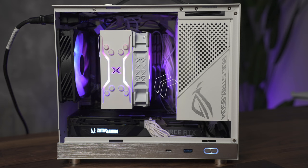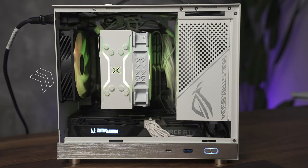One fan attached to the CPU cooler, and another helping exhaust out the back. You can install two 120 millimeter fans at the bottom, but like I mentioned before, they need to be thin. Otherwise, they will interfere with the GPU. Personally, I think that the GPU will be pulling in enough air on its own, so additional fans in these positions is not really necessary.